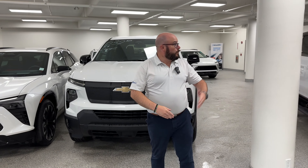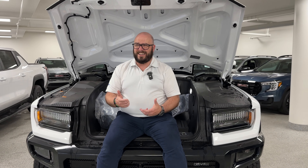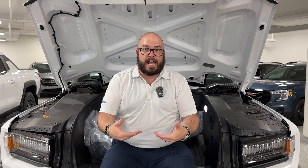When you start looking at winter driving, previously you had ranges of 90 kilometers on a charge that dropped to about 40 percent once you got into winter — and let's face it, we're in Canada, winter is here half the time. We now have much higher starting numbers like 449, 632, 448 kilometers, all of which give us a much better starting point. They're also losing on average only about 25 percent of their range down to minus 30 for a full week, and they're doing that with the heat pump. In previous generations of electric vehicles, they used resistive heating — kind of like a kettle, you push the button and it heats from the bottom — which is super inefficient. What they're doing with the Ultium is more like a reverse refrigerator: they're actually taking some of the energy and heat that the battery, the brakes, and the motor all create, and pumping it back into the cabin. That's how they're maintaining those crazy long ranges and not losing them in the winter.